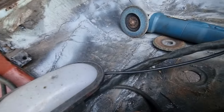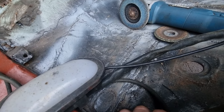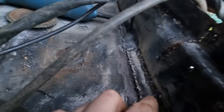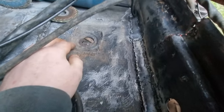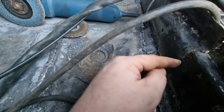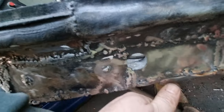Some people on YouTube, my subscribers say to weld everything up basically, because the seams on these Cortinas are not very good anyway. So I've started welding all the top all the way across. So that is welded. I've got one little hole there, a couple of holes there. But these are welded to the side of the floor now from the inside and the outside.